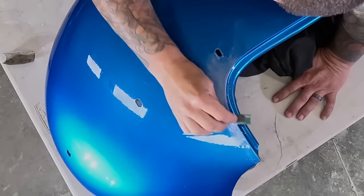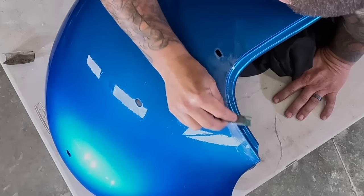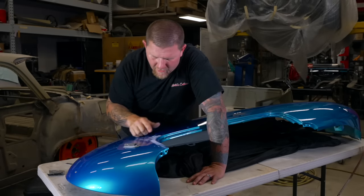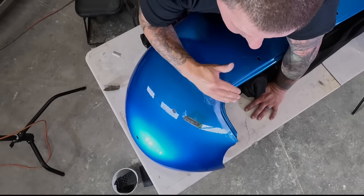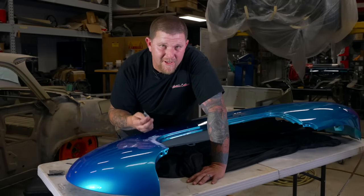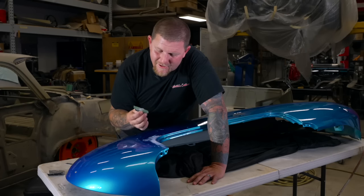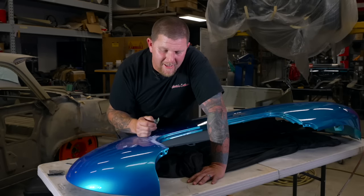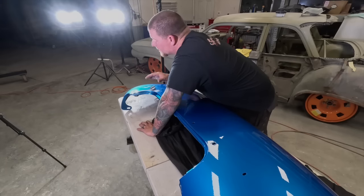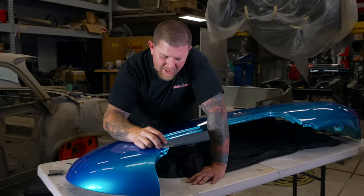Don't tip over or bring your finger beyond the edge, because you'll just roll over the speed bump and burn that sharp edge. I always wet sand these edges with 600 before paint so I have a little round barrier and not a tight pattern that burns through easily. Work it down until you don't see that shiny area between the edge and the flat part of the panel. Making every pass count — once it's flat, continue moving without creating a thin spot. Then use Mirka guide coat and upgrade to 600 wet, 1,000, or whatever you're going to do. If using 320, make sure you have a good solid clear with lots of coats.